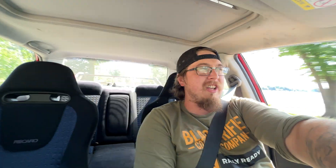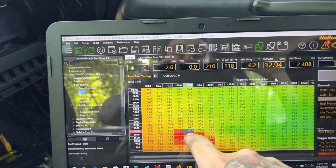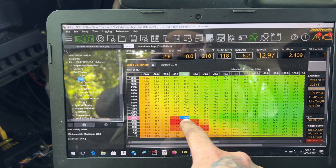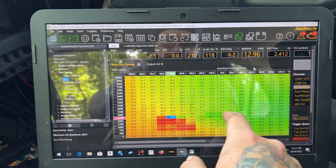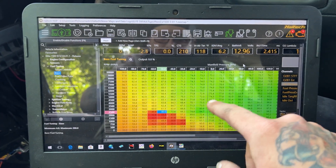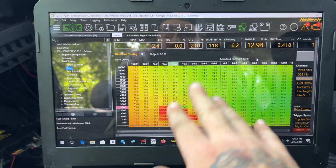I'm going to put this on record, probably just on time lapse. One problem I'm running into is my MAP sensor doesn't read below negative 50 kpa or negative 15 inches of vacuum, so this one cell is being problematic and I've had to add a lot of fuel in that area. Once that's good we can start working on the boost area. I'm going to save this file and go for another drive.